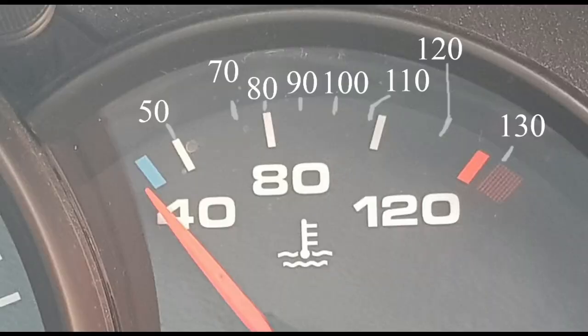As you can see from the results, the temperatures are squashed up rather close to the middle, so during the normal temperature operating window of the engine the needle won't move a great deal. But as it gets too hot it will start moving a lot faster. So as you can see, when you go above 110 degrees it moves much quicker.